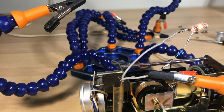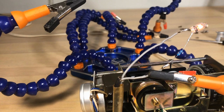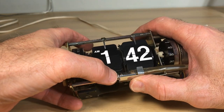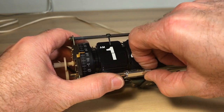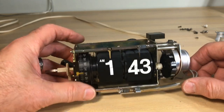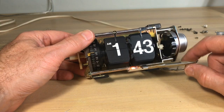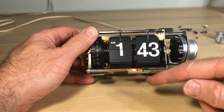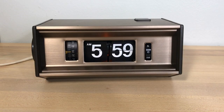When it powers on, the motor kicks on right away — and it does, pretty much. It's going to run for a while with some lubricant on it. We've got a really good light here with very good output. Now because the bulb is a little bit shorter, you push this tab in — the holder was designed so you can push this in and get the position you want before you crimp down the other side. Everything seems to be in good position. We're going to power on, test, and probably put one more drop of oil, let it run overnight. So there it is — Copal model 702, got a working motor, working light. I hope this little tutorial helps someone. Thanks for taking the time.